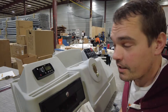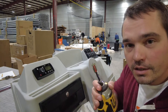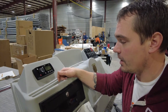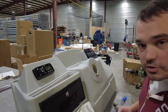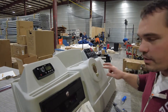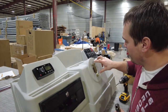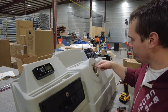Another reason not to push too hard when driving a screw — if your drill bit comes off the screw, you're going to leave a mark in the rotomolded plastic. If it's fiberglass you might scuff it up, and if your finger gets in the way, you'll put a hole in it. I'm going to drill three 5/16 holes for this bracket so I can run the hardware through, then tighten all three bolts nice and snug so I can run the steering helm up through.